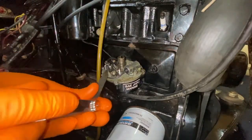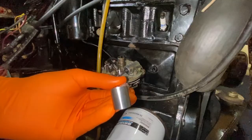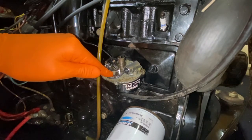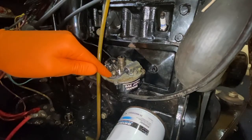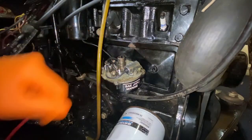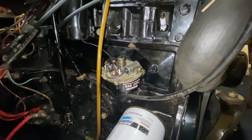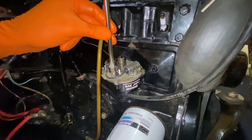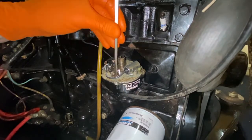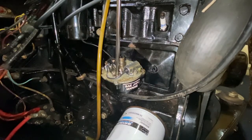There is a little bit of rubbing, and I'll do my best to center it up. On that high point, you want to be able to just shift the feeler inside that gap. To adjust, you've got a flathead screw just to the left — loosen that ever so slightly. On the actual plate itself, you have an oval machine cut where that screw goes through, and that oval machine cut will allow you to move this entire point to the right or left. Right down here is a machine cut in the top aluminum plate that allows you to insert a flathead screwdriver and carefully move the point back and forth to properly set your point. I'll carefully come from above and loosen up the flathead screw, then insert a smaller tip flathead screwdriver inside that little slot — as you can see, I can move the point.